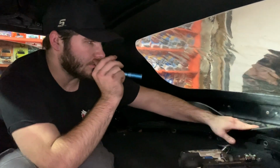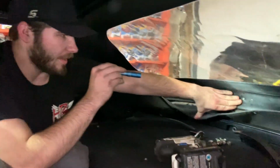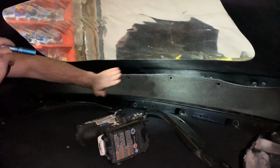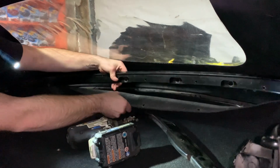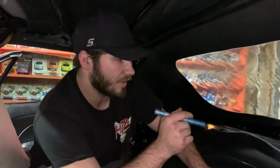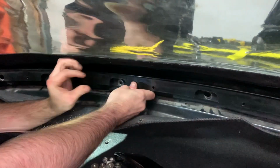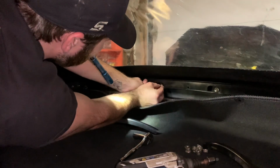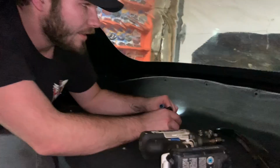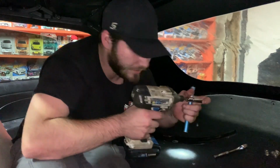In this part, we're not going to do a time lapse so you guys can listen and see a little bit better. The soft top's in first, and then next go these trim pieces to hold the soft top in. We'll line it up and hand tighten the nuts just to hold it in place for now, and then we'll go by and tighten everything. If we did not make this clear before, it definitely helps if you have more than one person. Yes, definitely. You tighten the couple that you have on, it'll pull it tighter, so then it'll be easier to hand thread all of the other ones.